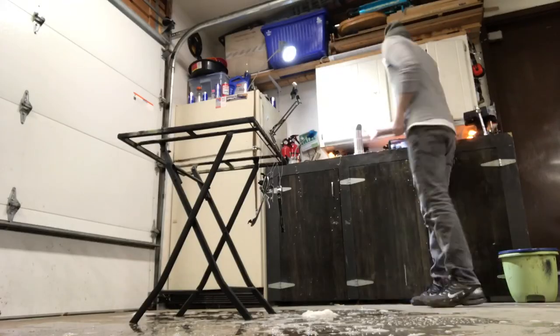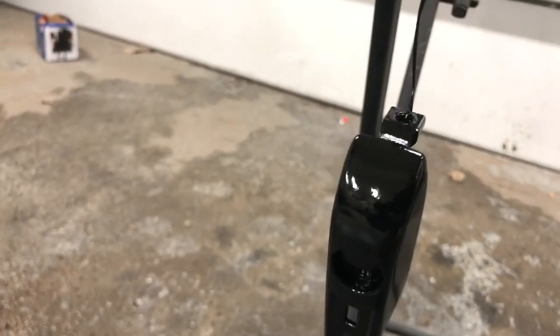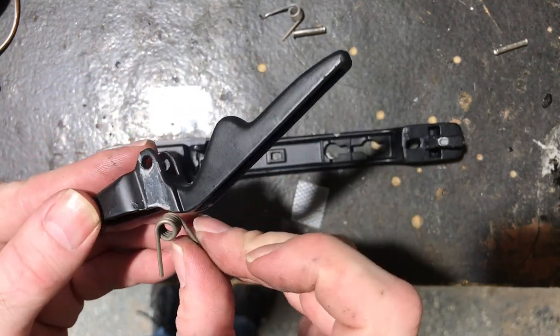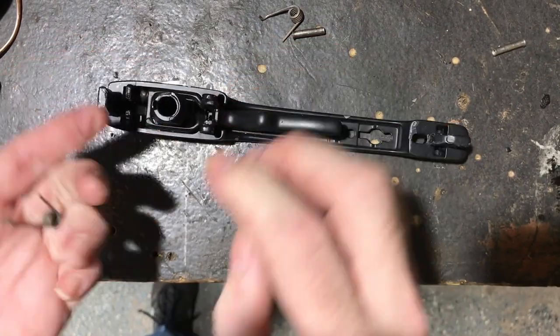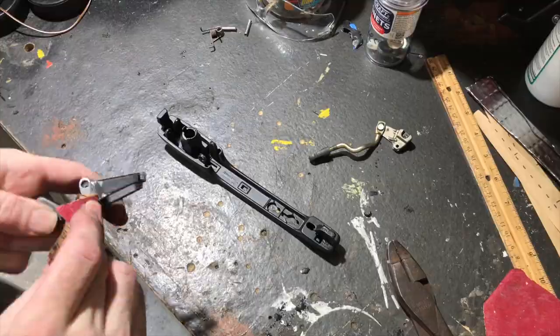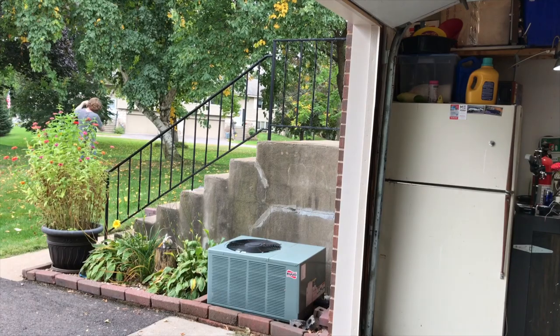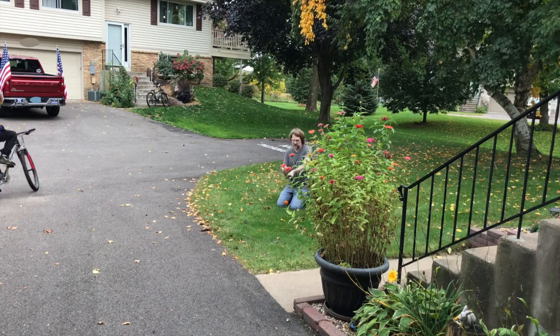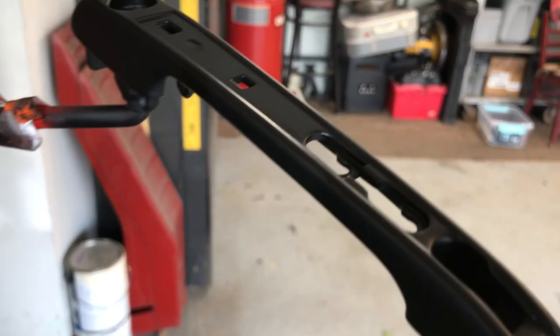I put on my painting gear and used a heat gun in the middle. This paint looked really good when it was done, but unfortunately after laying on too many layers it was just too thick, and it chipped when I tried to put the handles together. So I sanded inside there and did some clearancing. Then I decided to reshoot the black paint with just a high-performance Rust-Oleum enamel without any primer — I wanted to keep the coat thin. When I was done, it was way harder than the last coat of paint.